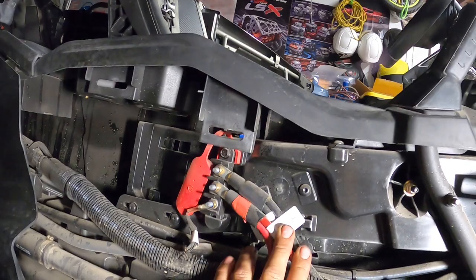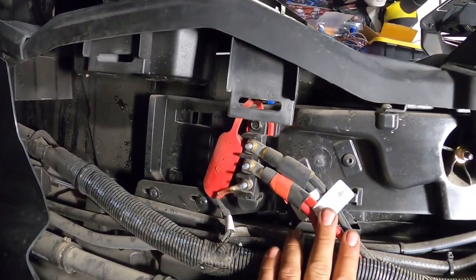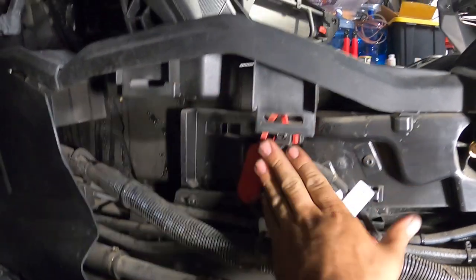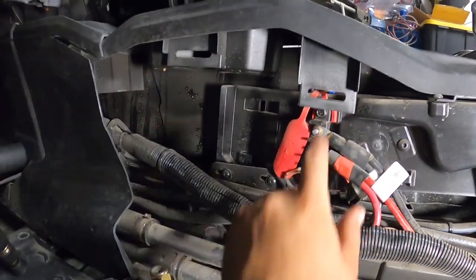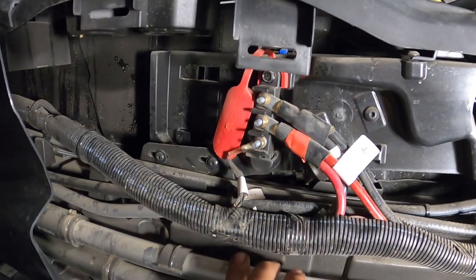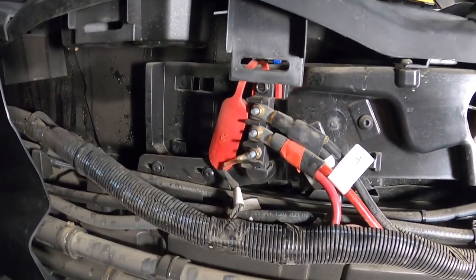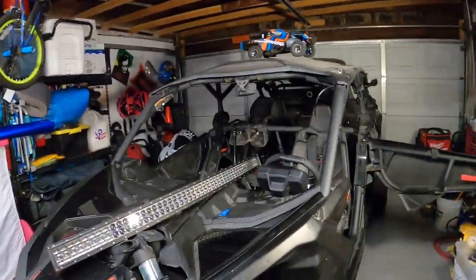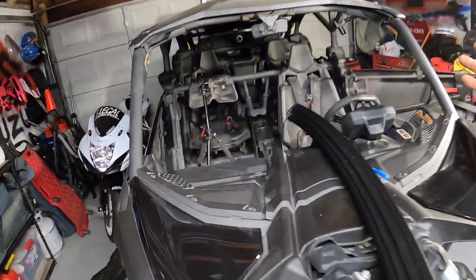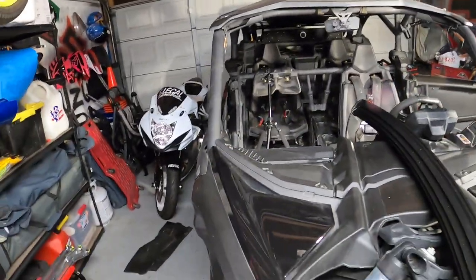Can-Am put this bus bar specifically for customers to run accessories — light bars, chase lights, horns, sirens, whatever you want. If you don't want to run wiring all the way back to the battery, this is the best spot. You've got a negative, a positive, and the bottom terminal is your ignition-on circuit — on these Can-Ams it's actually vehicle-on, so it has power when the engine is running, which enables your lights. That's it for this video — I wanted to show you the bus bar and how to run wiring through the tubes. Let me know what methods you've used in the comments. See you guys next time!